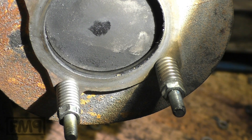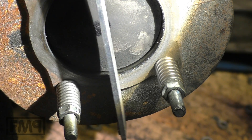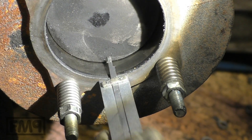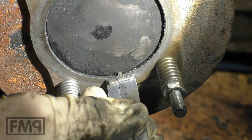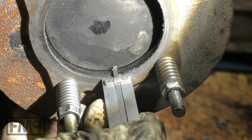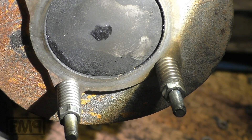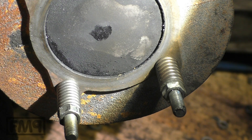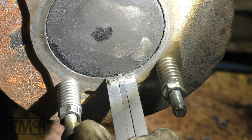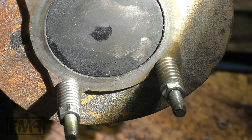You should measure it where the piston bolt sits — and it sits here, so you measure at this spot. Without bottom gasket it seems to be 0.6. Measure three times, you can take the average — 0.6, 0.6 it is.